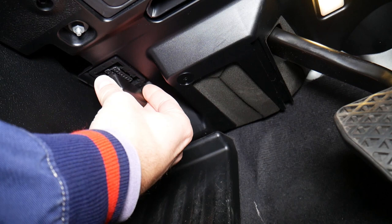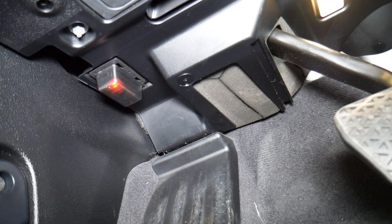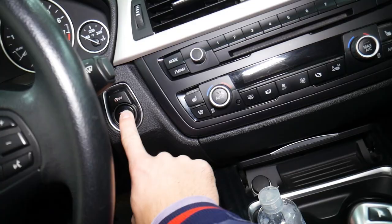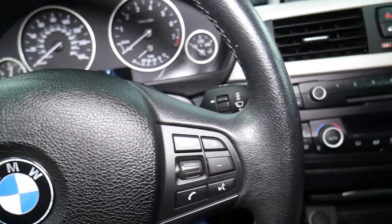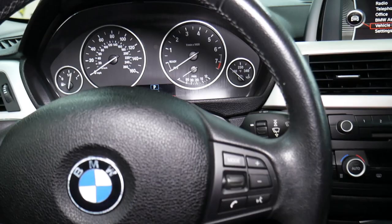I'm going to go ahead and plug it in here — it's a very tight fit. You will see lights come on, and once it connects, you'll have one green light blinking. It's recommended to have the ignition switch on and a battery charger connected to keep constant supply on the battery, because when doing coding and diagnostics you should have stable voltage above 12.5 volts.